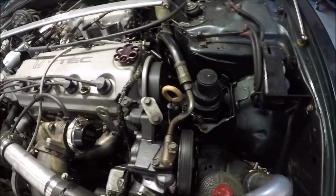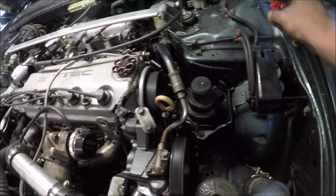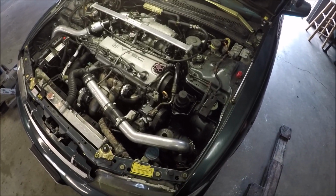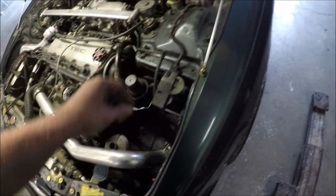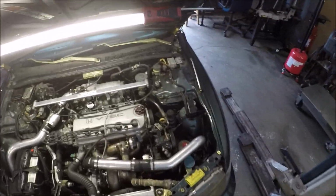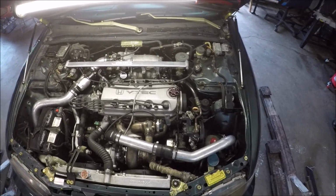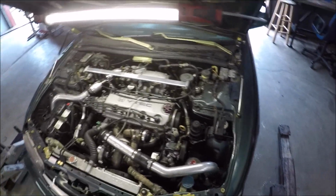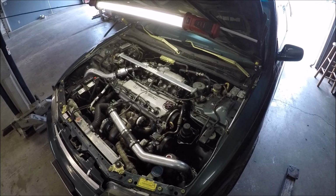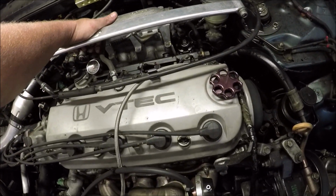Power steering sounds like crap. Need some fluid. Get on that. Well, the power steering pump, I just wasted that fluid. As I was pouring it in, I remembered why it was making noise. This thing just pukes power steering fluid out from the steering rack. We weren't given the go-ahead to fix that, so she's not fixed. So I don't need to put fluid in it. So there'll be a little bit of leakage on the ground now since I put a little bit in there. But I'm gonna let this thing just warm up, get hot, and burn the oil off the downpipe.